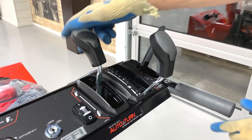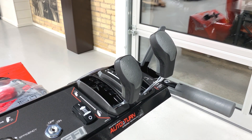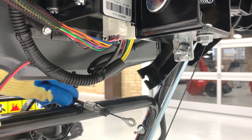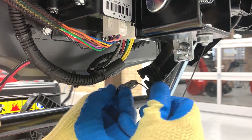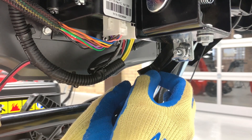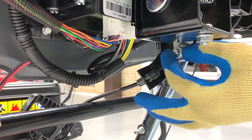Move the chute deflector lever to the rearmost detent on the dash panel. Remove the hairpin and the bushing from the deflector lever under the dash. Route the chute deflector cable over the lower handlebars, pull the rubber boot away from the cable anchor, insert the anchor into the anchor bracket, and install the cable eyelet onto the deflector lever. Reposition the rubber boot against the cable anchor and reinstall the bushing and the hairpin removed earlier.